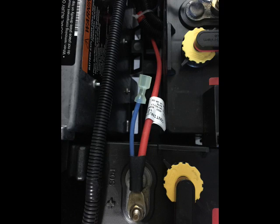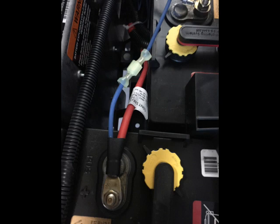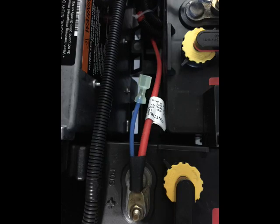It's also important to know that the ERIC charging system is used in the 2014 Precedent Club Car and current models. If you're wondering what the blue wire is that's connected to your PD system, IQ system, or your ERIC system, please note this is for your accessories. It is important that prior to winter storage you unplug this blue wire, as it will disconnect the inverter to your car, as shown in this illustration.